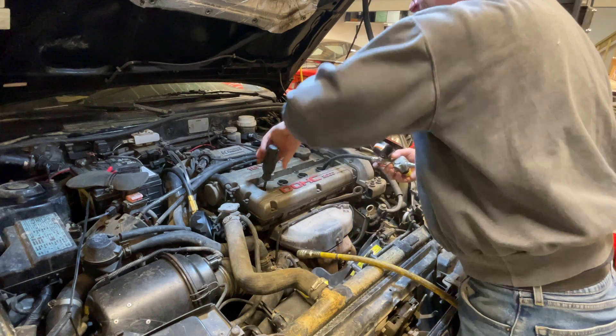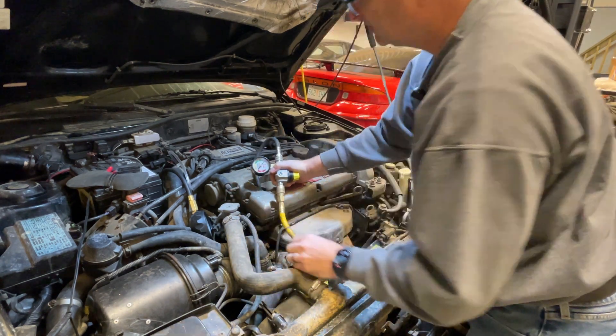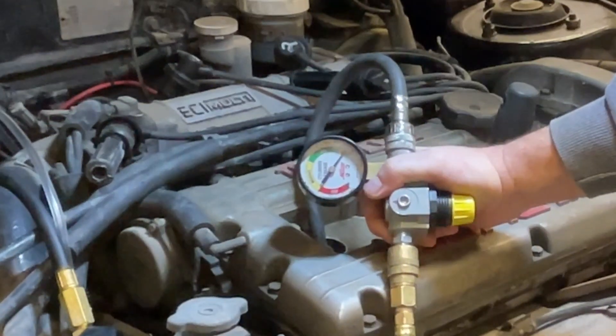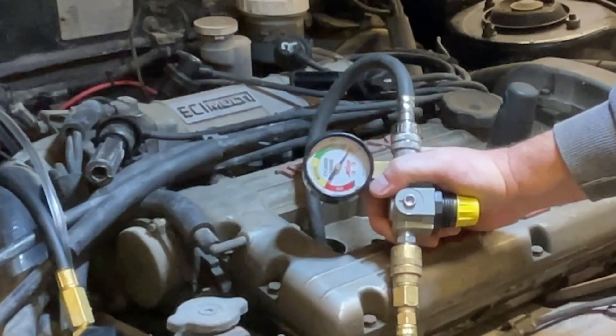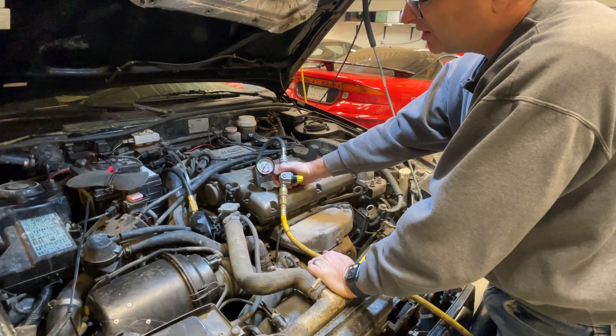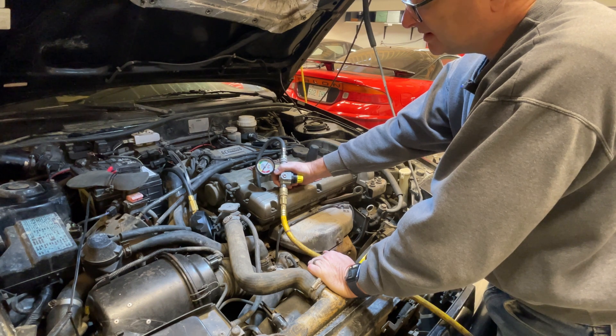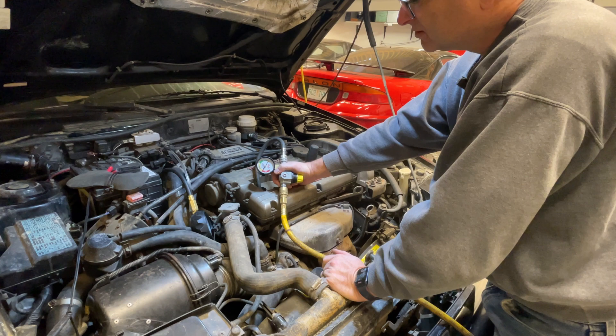So let's move it out and plug it into the correct cylinder. I have basically no leaks at all on this one — that is excellent for a leak down test. You can't get any better than that. It's essentially where I set it during setup, so there's really no leaks in this cylinder at all, which is awesome.